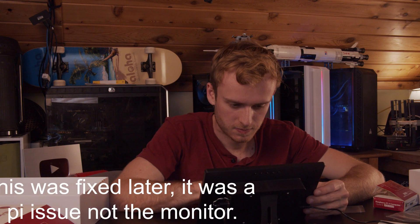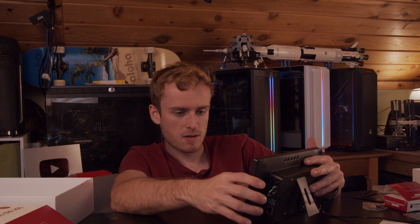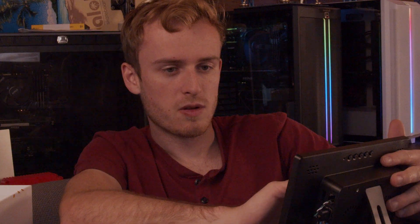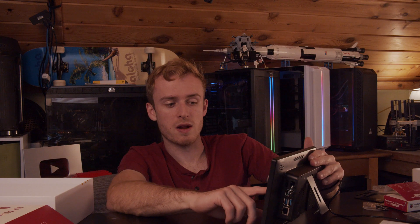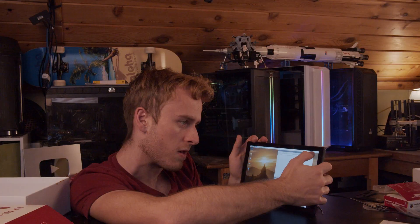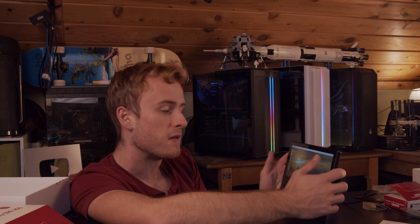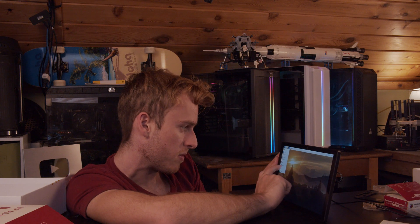Touch feedback is a little delayed — a little bit off, actually. I'd say there's probably a 5 to 10 millisecond delay on the mouse and input. I don't know if that comes from screen delay or whatever. But overall it's capacitive touch, meaning you're not pressing between two screens to make contact — it's similar to iPads or modern phones. The screen itself isn't that precise, especially when you're trying to close something. You have to be really fine and detailed, and even then you're still struggling a bit. I would obviously increase the scale of some of the icons, but even with the increase in size it's still not as precise as I'd like.